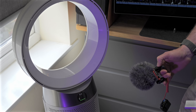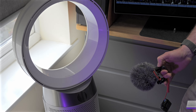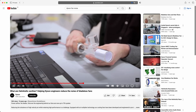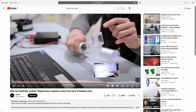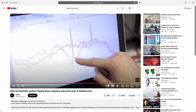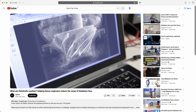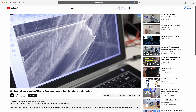A lot of people actually seek out white noise because they find it so soothing, so that's a really significant point that's obviously overlooked if you're just comparing on decibels alone. There's so much design engineering that's gone into these fans to make them sound as pleasant as they do. They use Helmholtz cavities to adjust certain frequencies and balance things out, the impeller design has weird shapes on the ends of the fins to change the sound, and the design is asymmetrical so that it harmonizes and balances out the sound. If you ever compare them side by side, it's immediately obvious.